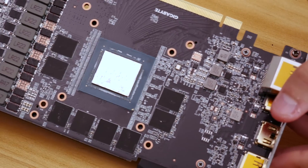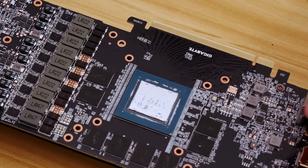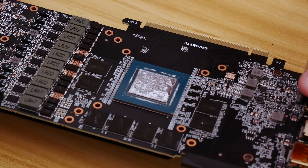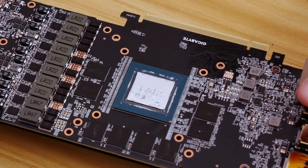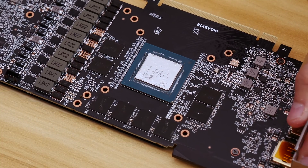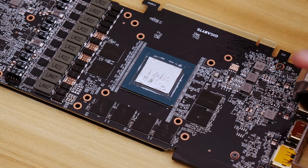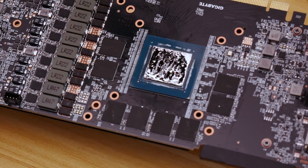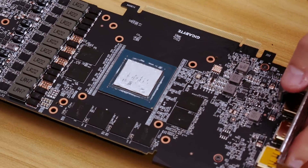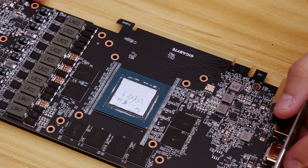I'm pretty sure I have covered the entire die. I've never done this before. I've never applied liquid metal to a graphics card. I figured Turing would be a chance to go all in and just put it all on the line — all $800 or so of hardware that Gigabyte sent me — and just wing it. I have no idea if temperatures are even going to drop by a significant enough amount where it might be worth it. Maybe the card runs cooler, maybe it runs quieter as a result. And I don't even know if I'm going to fry the card.